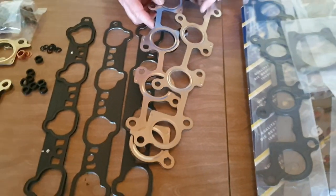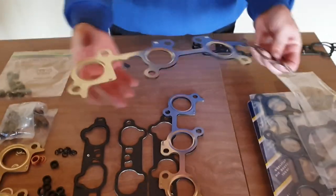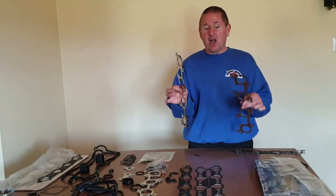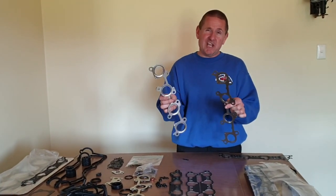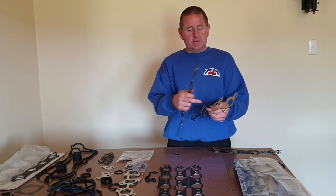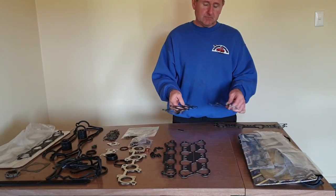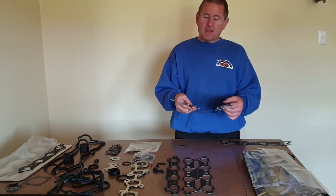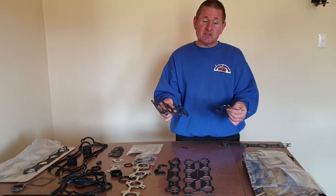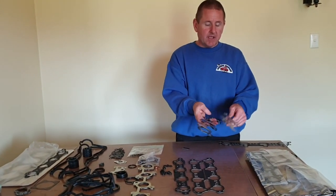The exhaust gasket is again definitely a copy — none of the little dimples on the side. I'd like to compare the hole size, because not everyone knows there are two sizes of exhaust holes in exhaust gaskets. The really early crowns had the big hole, the UCF-10 had the smaller holes, UCF-20s went back to the bigger holes, and VVTis I think are the bigger holes too. The 2UZs are definitely the bigger one. The port sizes though are the same — it's just the way it lines up on the exhaust manifold. The cheap copy is still steel laminated and it isn't actually too bad — it's got a pronounced ridge; it's not a bad gasket.